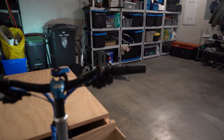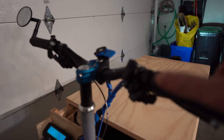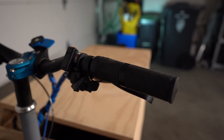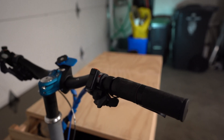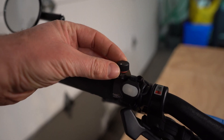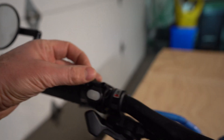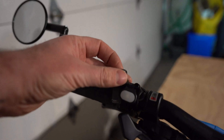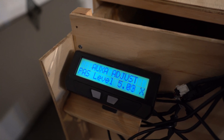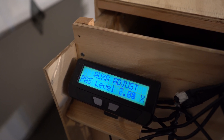Because I was using rapid-fire shifters with the Sram X5 system, I couldn't fit a thumb throttle, so I ended up using a motorcycle half-twist throttle and it works really well. On the left I have an auxiliary potentiometer set up as an amplifier for the pedal assist — so it's got both throttle and pedal assist, and as you adjust it you can see the multiplier of the input watts from my legs being translated through that multiplier.